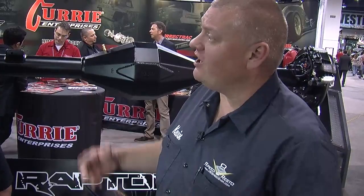Are we seeing a difference in the makeup of a rear axle assembly designed for drag racing versus what's popular today as autocross and road racing for a muscle car? There are some different things those guys are looking for — a lot of it has to do with suspension setup. Autocross is getting very popular. An autocross car needs to do a combination of things really well. They're not going to run a spool or a Detroit locker in their autocross car — they're probably going to run some kind of spiral bevel gear differential or some kind of positraction. In a drag car, you're going to run some kind of a four-link, whereas the autocross car might use something more like a watts linkage or a triangle four-link and a panhard bar.